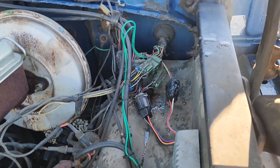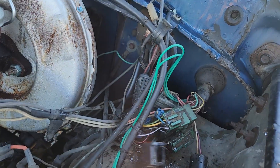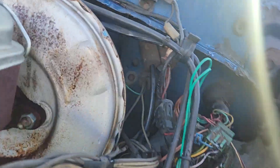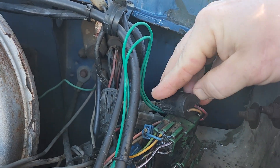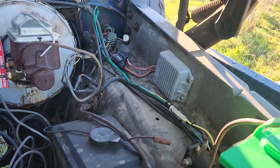These plugs — look at this. These plugs are trash. These all come out of the firewall and the problem is where these wires connect down here — a lot of these will separate and break because all this sits in here and vibrates. This module has been replaced about three million times; it's what every Ford person has ever dealt with — that stupid ignition control module.